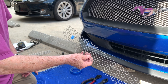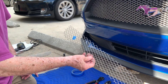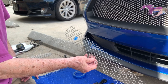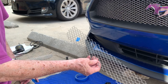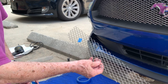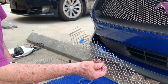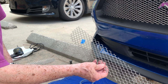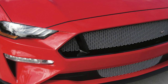You will need to make sure that the lower grille is facing forward in the same manner as the upper grille. There is a subtle difference in appearance between the front and back of the diamond grille. If you have the upper grille one way and the lower grille in the opposite way, under certain lighting conditions the two will look different. Closely examine the two and put a piece of tape on the front of the lower grille to identify which way to install it. If your diamond grille is one without the Mustang pony emblem, just make sure both grilles are facing the same way.